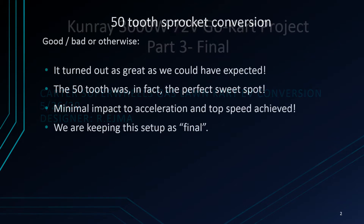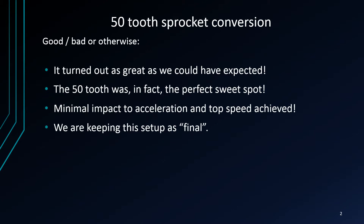So what was the change? We talked about this magical 50-tooth sprocket. The first runs we had a 60-tooth, which is very common, and that gave great acceleration, great motor load, and outstanding range. We tried the 40-tooth sprocket and it could not even hit the theoretical top speed of 37 because it was just too much load on the motor. So I logically assumed that the middle ground, a 50-tooth, would be optimal given that there seemed to be some meat on the bones with the 60-tooth sprocket and the top speed with that.